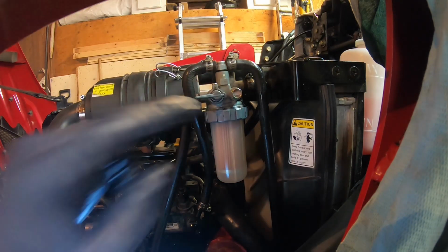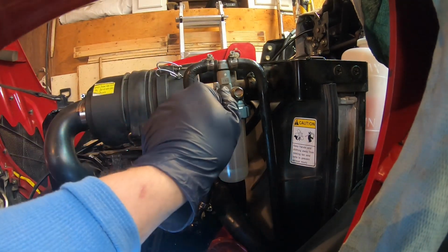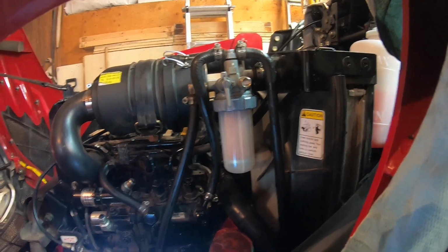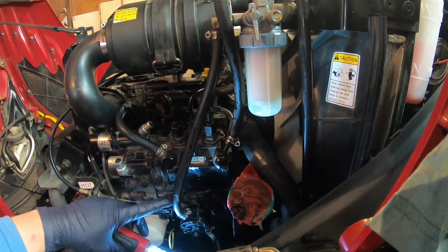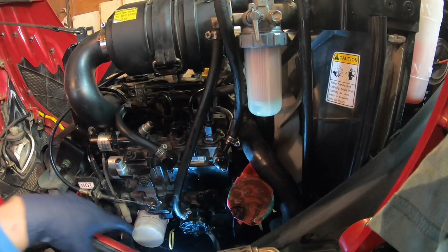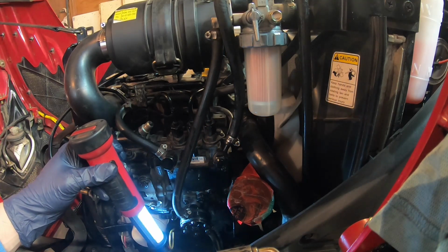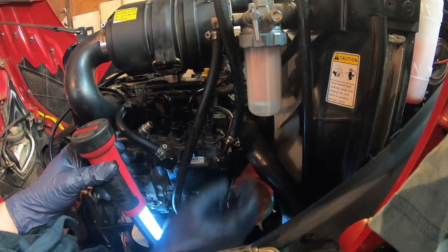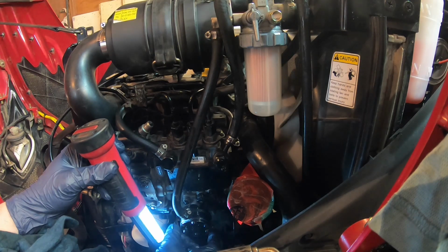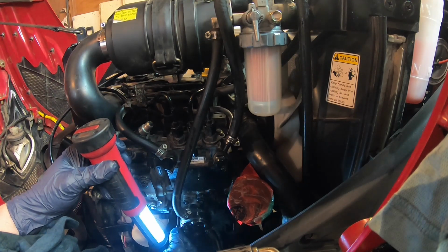You open the valve here. You open it like this, and I'm just gonna try to show it to you. You see that little lever in here, I'm pushing, it's black, so just hold on, I'll try to find a better camera view so you can see it better. And you're going to see the fuel bowl there. So I just start pushing, and look at the little flow coming up. What you need to do is start to fill up the bowl like this.